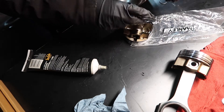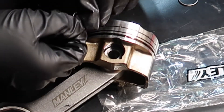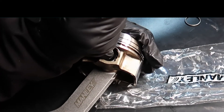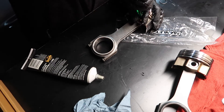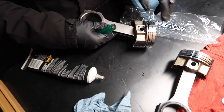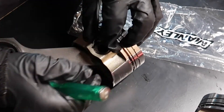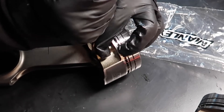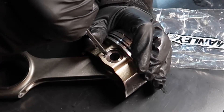The circlips are a little tricky — actually trickier to remove than to put in. You can see a little curve and a little dot, so go to the longest side of the dot, touch it there, then go down and push down. There you go — this side is done. For the other side, same thing: get in from the long side and use the wall of the piston to help push it down. Done.